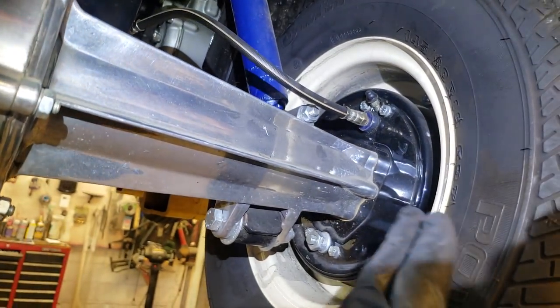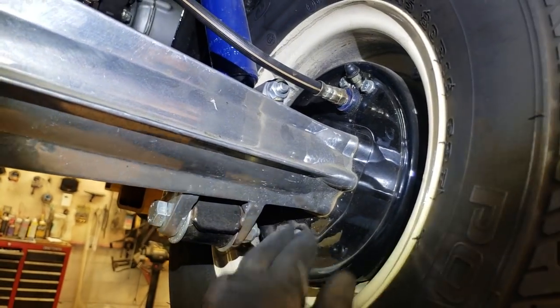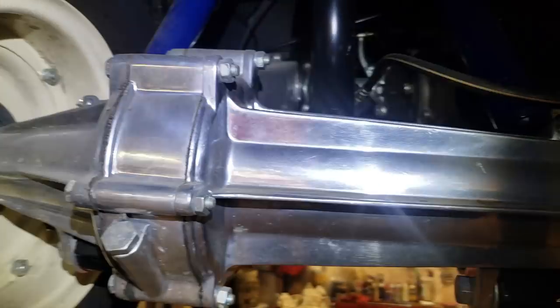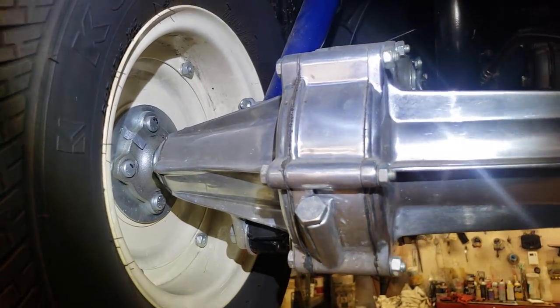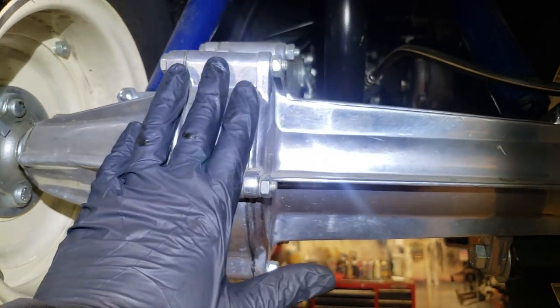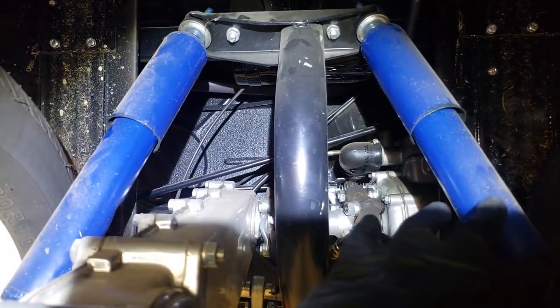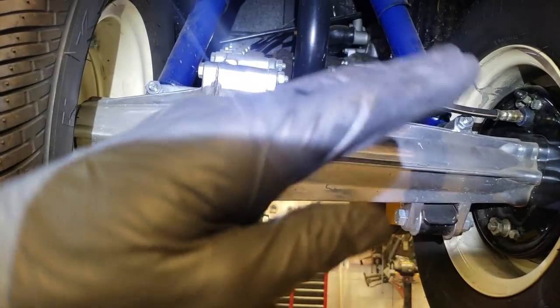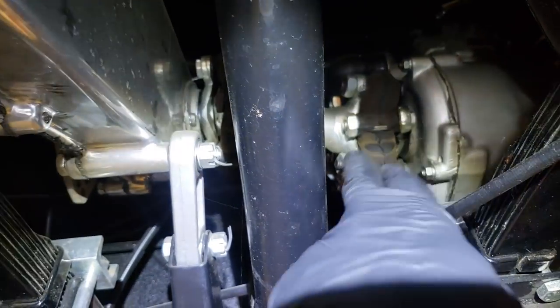As I was talking about, there is a brake only on one side. You can see the backing plate, the adjuster, the wheel cylinder, and then on this side there is nothing — it's basically a trailer. So we've got our chain case with live axle which is enclosed with oil. We've got our gas shock absorbers — these blue things here — and of course there are two of those because the axle can fluctuate either way. And what actually powers the axle are these couplings.